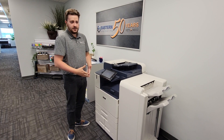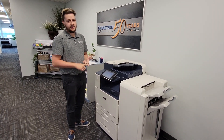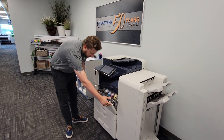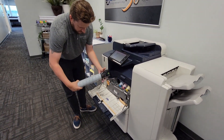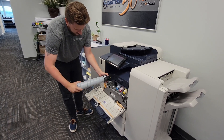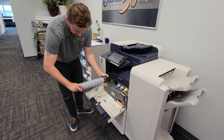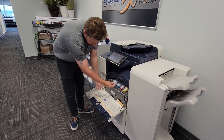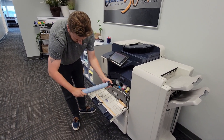Your gear noise can most likely be from your toner cartridges. The toner inside can harden up. To get to your toner cartridges, just pop this front cover open and each one pulls out. Hold it by the black bit, grab it on the end, and give it a spin — that'll loosen up any hardened toner in there. Each one is the same; the other cartridges are just a little bit smaller but you take them out and spin them around the same way.